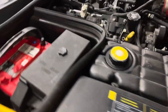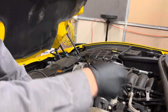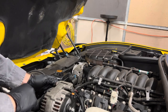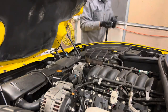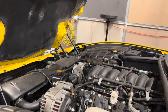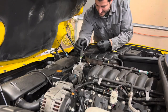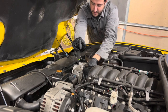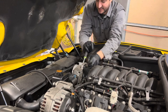First thing I'm going to do is disconnect the battery terminal. The alternator bolt back here is 13 millimeter, this is 15 millimeters, and the one at the bottom is 15 millimeters. I loosened that up enough to slip off the belt — use a 15 millimeter socket, not a wrench, to get this off and you just slip it off. When you pull the belt off it'll rest right on the socket; if you use a wrench it's going to stay stuck there.